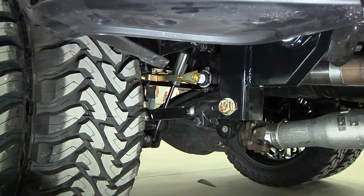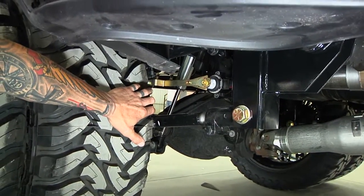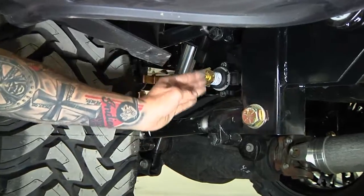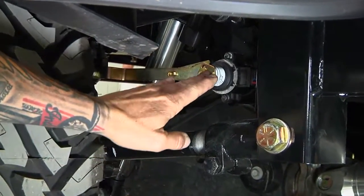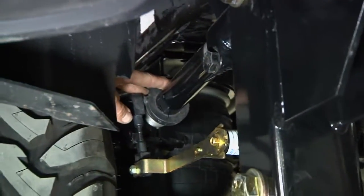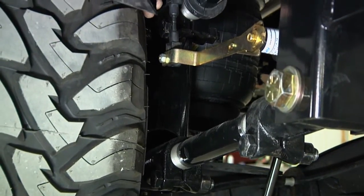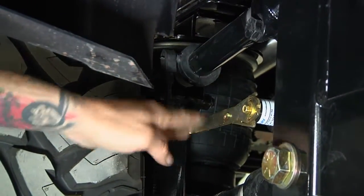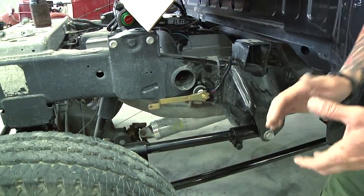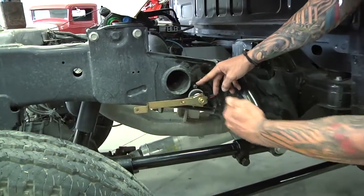What we've got here is the sensor placement on the rear of a 3500 Dodge 5 to 6 inch lift. We've got our two bolts straight up and down with our main body, straight out at ride height. This one is connected to the top trailing arm — it could go to the bottom trailing arm, it's not going to make any difference. We're in the middle of installation, already drilled and tapped in the side of the frame with the bolts straight up and down.